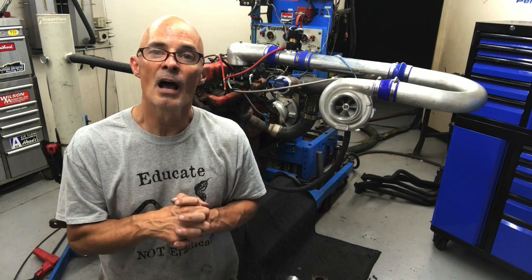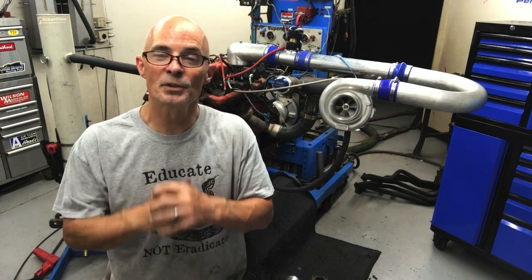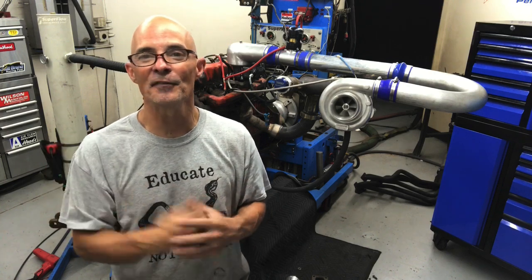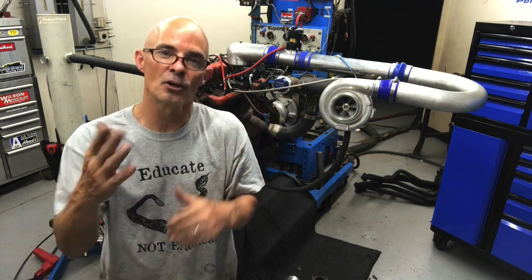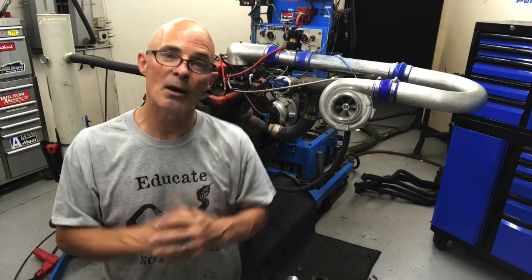I also changed the jet in our 2-barrel carburetor. Remember, it's just a Holley 2-barrel. It's not a dedicated blow-through carburetor, it's just a carburetor that I'm blowing through. But we did have to change the jets. It comes from the factory with 74 jets, and I'm all the way up to 96 jets to get the air-fuel that I want, in the mid 11s or so. It starts out a little bit leaner and then transitions rich. I'll show you guys the air-fuel curve. I'll put it up here so you can look at it. But that's how we're running right now.